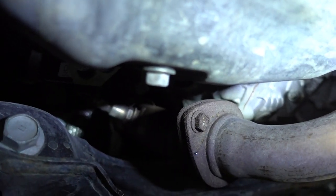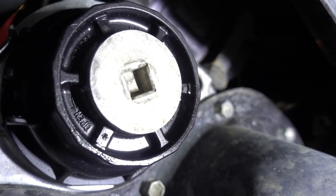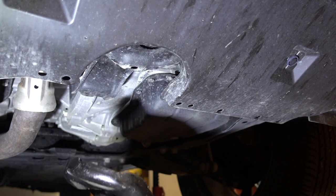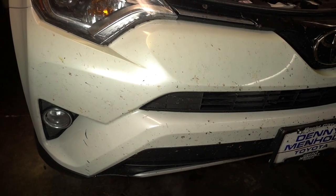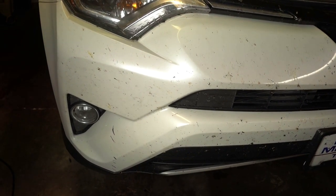There's the oil drain right there. I'm finding I could do this work without jacking the car up, but I'm going to jack it up so I can get the camera in here for you. The oil filter housing is right there. This spot at the front center is a recommended area for jacking up the car. Jack stands are right on the pinch welds where it's recommended by the factory. Always change oil with a warmed up engine — that allows contaminants to flow out more freely. After you jack up the car on the jack stands, always bump it with your hips to make sure it doesn't fall. Just a safety consideration.